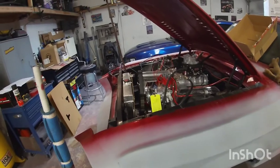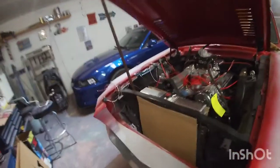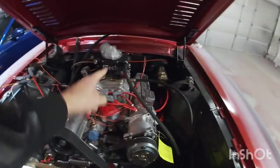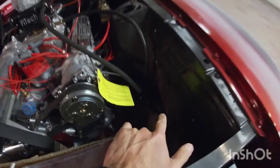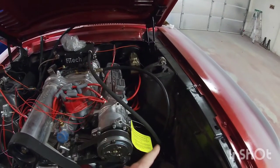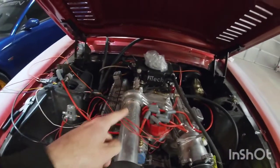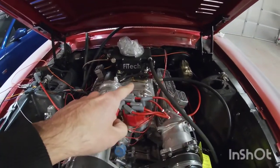To get started here, I already did the fuel injection unit — I put it on there. Obviously got the fuel lines routed. I did finally get a bigger step drill bit to drill those holes bigger so I can put a big grommet in there so the lines won't get damaged. I installed a nitrous plate, so I gotta finish putting hose clamps on the fuel line going to the nitrous.